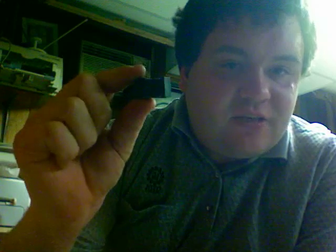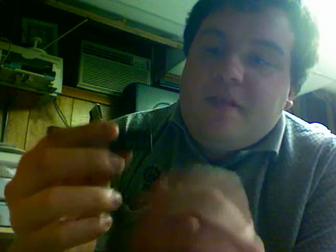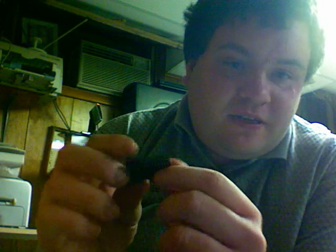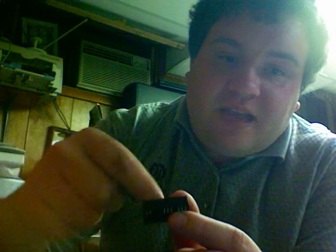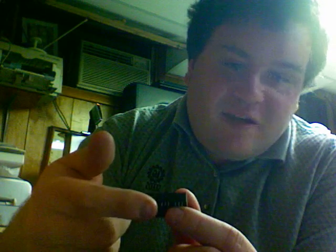For example, this DS-1287 has a batteryless equivalent in the DS-1285. So if you look at the DS-1285 data sheet, you can figure out where the battery terminals would be on this IC. It turns out that they're just flipped up inside this package and connected to the battery. The same is true for the clock crystal, which would be external on the DS-1285.